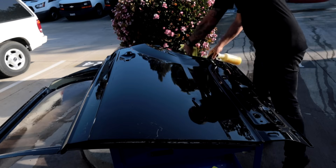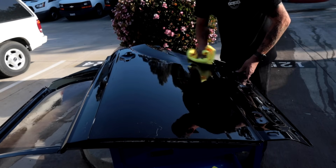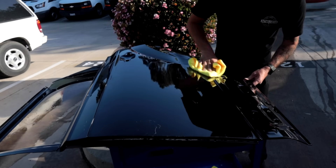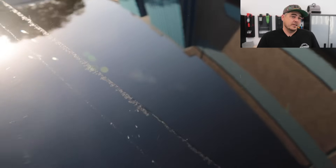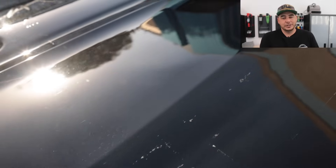From there I'll take my ceramic detail spray from Technician's Choice — my favorite product, linked in the description below. I just lightly misted it onto a microfiber towel. For this test I'm just using a basic Costco towel — we'll do another video in the future talking about Costco towels versus some other towels. Lightly misting it and then wiping down the whole panel. For our final result after the wipe down with the ceramic detail spray, everything's looking pretty good. The area that was not ceramic coated definitely has water spots — not as bad after the wipe down, but they are still there. The areas that were ceramic coated look great. However, these were relatively good temperatures and conditions for washing your car outside. If it was a hotter day, it might've been even worse.